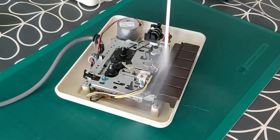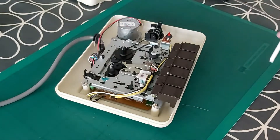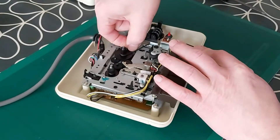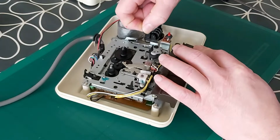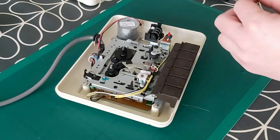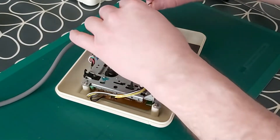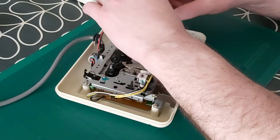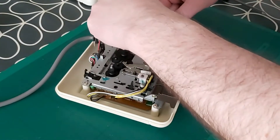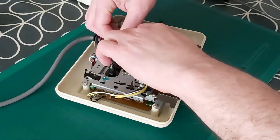So I've got the unit back into the back side of the shell. I'm just going to give it a quick blast with some air duster — just make sure there's no dirt in there — but fortunately on this one there isn't too much. And then I can change the belt for the counter. Again this came as part of the pack that I got as a replacement — a pack of two belts: one for the main drive belt and one for the counter. When taking that off you just need to unhook it from under the eject mechanism, that little eject arm. Then replace it in the same way — it attaches to one of the drive shafts, and the other end goes around a pulley on the counter itself.